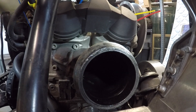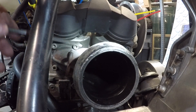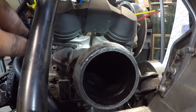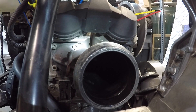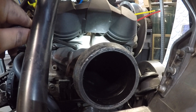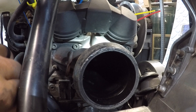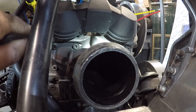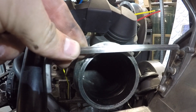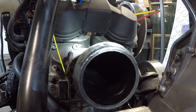This isn't the technical term, but this little exhaust piece — I'm going to call it a header because that's essentially what it is. We're going to take out these Allen screws; there are four on each side and they are a six millimeter. It's a little tight and time-consuming since I don't have my normal sockets, so I've got to use this big wrench right here.